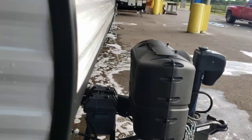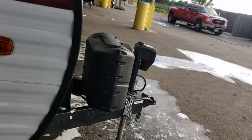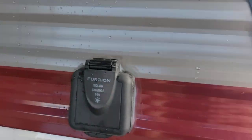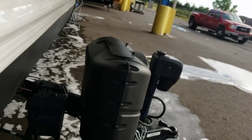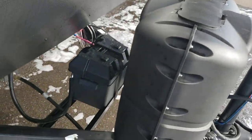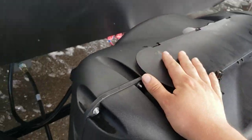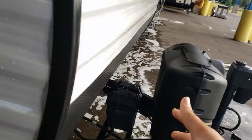Pre-wired for solar — that's wired straight to the battery for trickle charging off a solar panel. You have to buy the Furrion-branded solar charger to plug into this port. You could also buy a small trickle charger that you alligator clip right to your battery and just set the solar panel on top. But it's nice to have this port because it's already wired up.